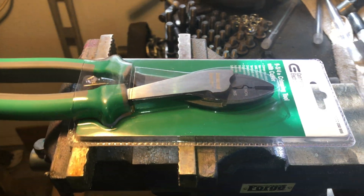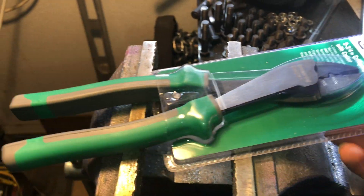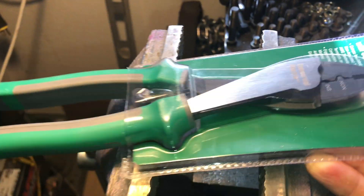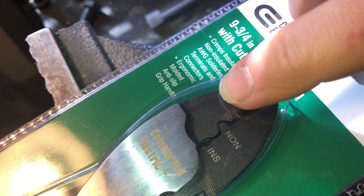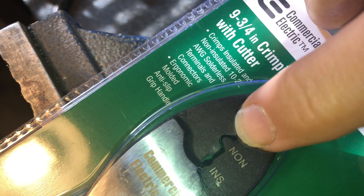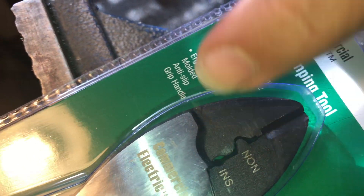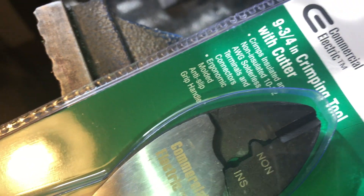What's happening everybody, welcome back - it's Monkey Mike here with Monkey Wrestling. Today we're gonna make a bead roller out of this crimping tool. The easiest way to do that is we're just gonna cut the top off right here, grind a little opening right there, take the nub off of the top side, and let's get right to it.